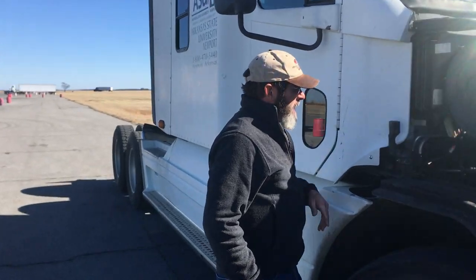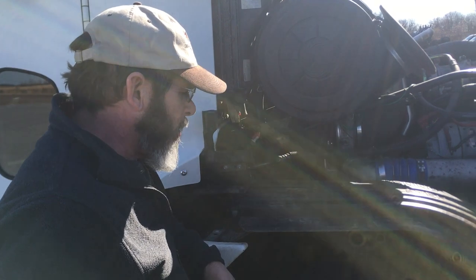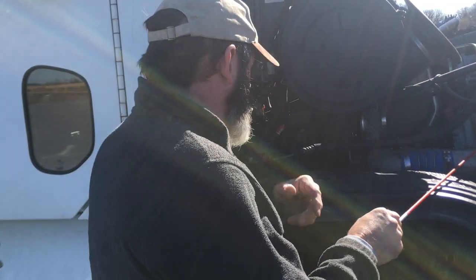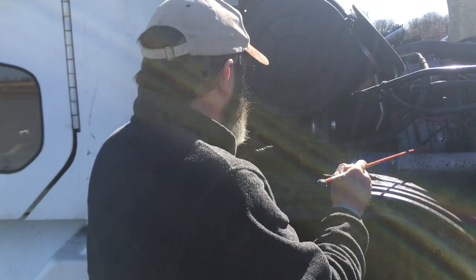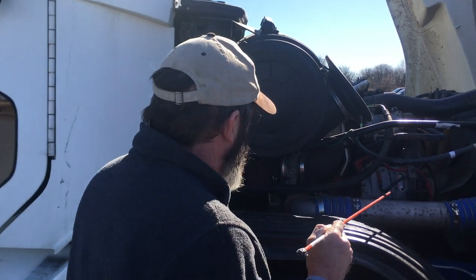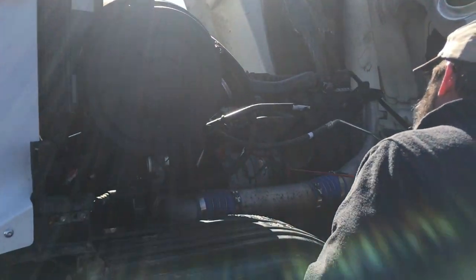We come to the right side, or the passenger side, of the engine compartment. I always check my oil first, but the oil dipstick and oil filler tube are on the other side, so I'm going to go to the next thing: the alternator. The alternator is securely mounted, not cracked or broke. Bolts and nuts are tight and secure, and the negative and hot wires are securely mounted. There are no bare or frayed wires. It is belt driven — I'll check the belts for play. There's no excessive play, no dry rot, no cuts.